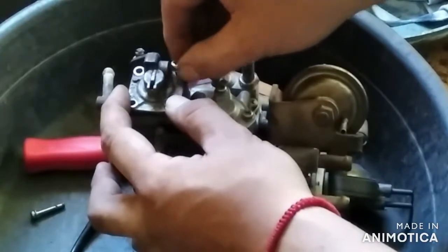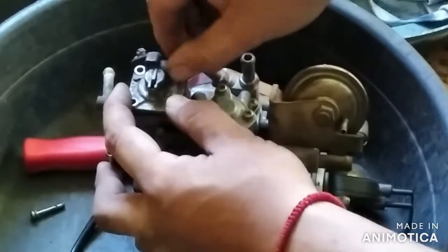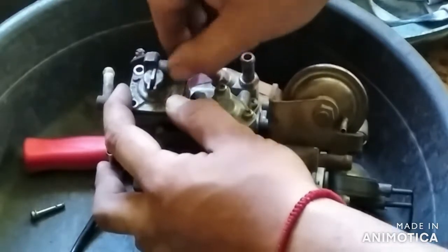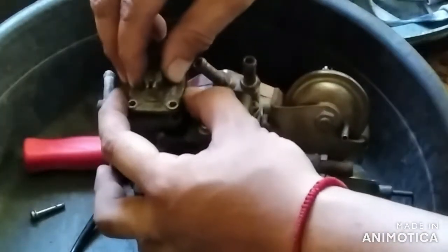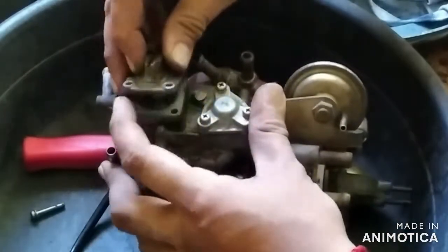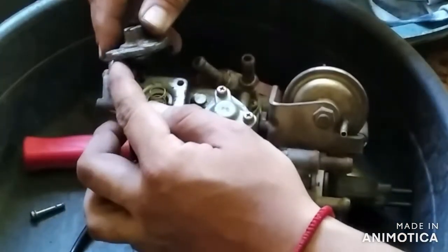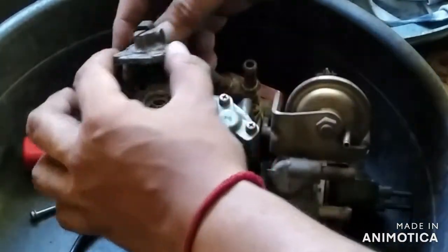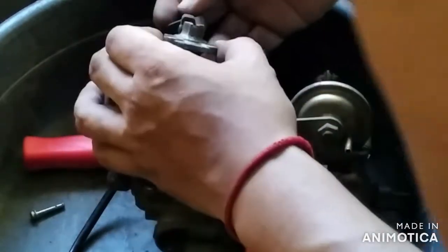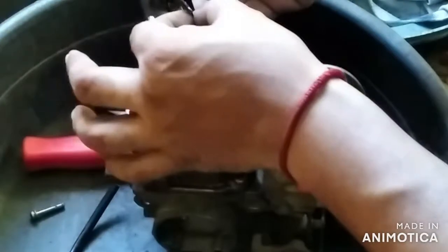When opening, be careful to not break or tear the gaskets apart, and be aware of springs holding the casing. Visual inspection on the diaphragm and the gasket for any wear and tear.